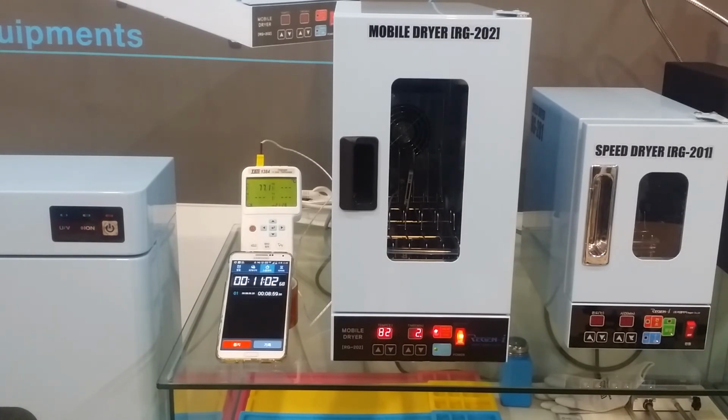So for the first defective smartphone, you have to spend about 8 minutes to reach 80 degrees. You may feel this is a bit slow, but we developed this machine to heat up the smartphone at a slow pace, so as not to influence the plastic case of the smartphone, because we fear overheating. That means once the temperature goes up to 80 degrees, although the rise is stopped, the temperature tends to keep going up. So we let the machine heat up slowly.